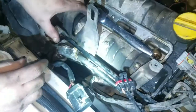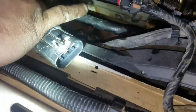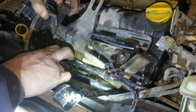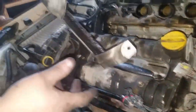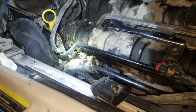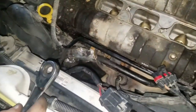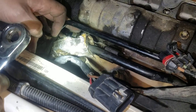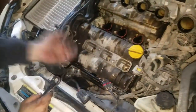After you remove the two bolts holding this in, you'll have to slide it this way and then you can pull it out — it'll be kind of a pain but it comes right out. This spot right here is the final bolt and it is an inverted torx E12 — the biggest size one on this side. It's going to be sliding out because it's what they use to pull the motor, so it grips around under the head and you'll have to slide it out to get it out.